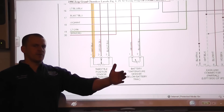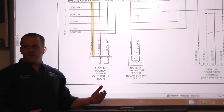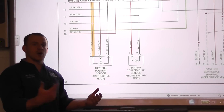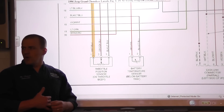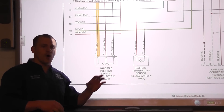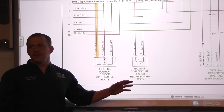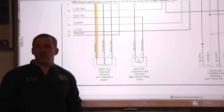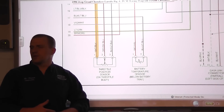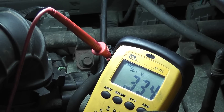What we're going to do is go back under the hood and measure at the TPS where we were before for the 5-volt reference, and we're going to start unplugging these sensors one at a time to hopefully isolate where our short is. If we have all these sensors unplugged and still don't have a 5-volt reference, then we're going to go after the fuses and check them next. That's the direction we're going.